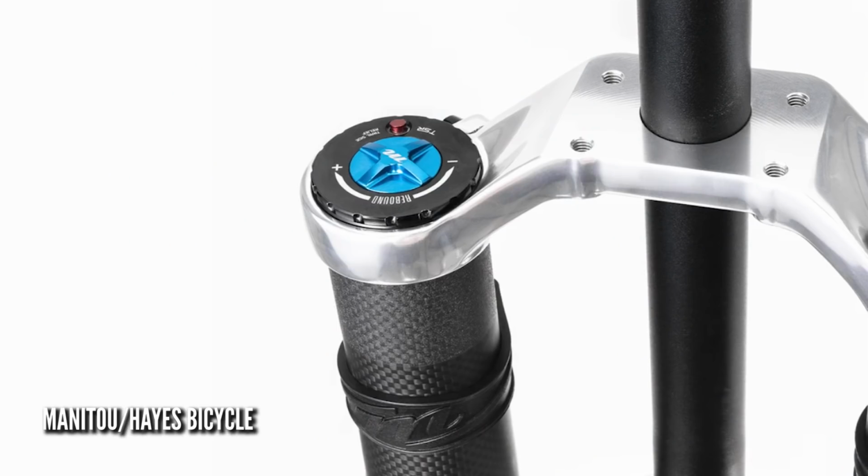On the insides, they have the TPC Plus cartridge. That is a twin piston chamber technology, an all-in-one cartridge, works incredibly well, and it has 3 major forms of damping adjustment on there. You have high and low speed compression, and you have rebound.